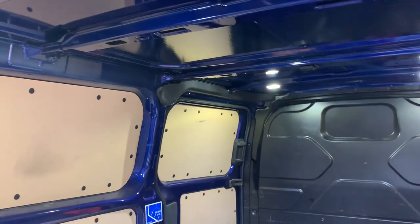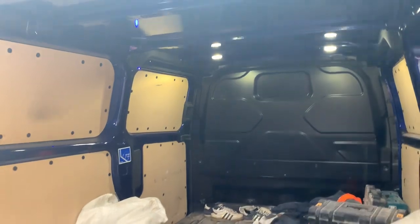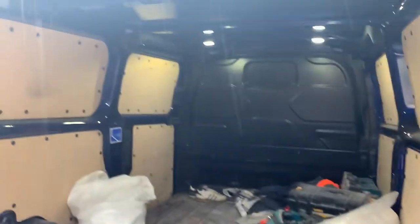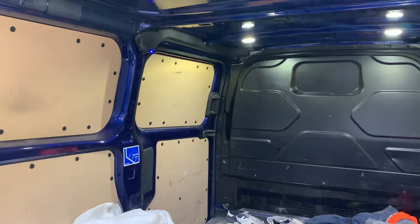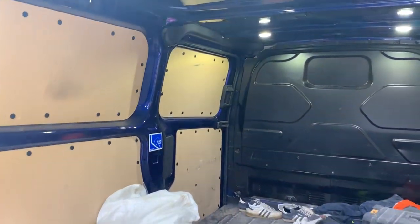Basically it's picking me up from the back door — if I'm waving my hands there, moving towards it, it'll detect actually outside the van. Obviously it won't when the van door's shut, because it'll bounce off the metalwork of the van door. As you see, I walk close towards the van — that's picking up. So that's going to pick up any entrance to the top door peeling, the side door peeling, if they came through any bodywork — it'll pick that up.